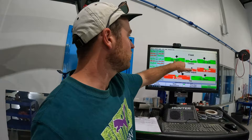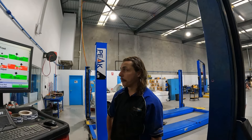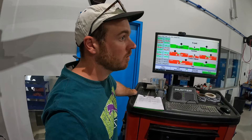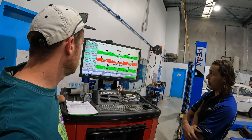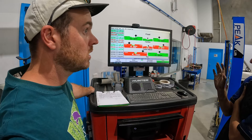The alignment targets are all relative — it depends on who aligns your car and what you're aligning it for. The ballpark would be around negative 0.3 or 0.25 degrees of camber, but that changes from car to car because of the geometries and what you use it for. In relation to what we do, they'll set it up with that little bit of camber to help with cornering so your wheels aren't leaning over too much, and because we do a lot of driving. Having the caster set forward also helps with ride on the highway.